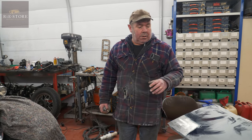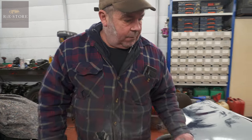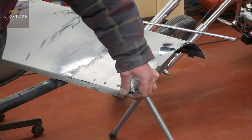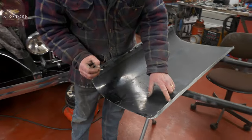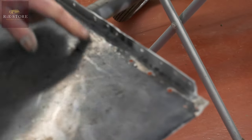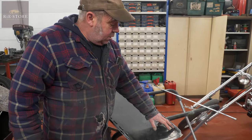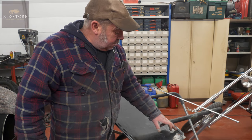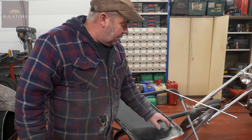He also asked to have the bonnets repaired. You can see that one's split there — that metal is no good, it's been welded but badly all the way in here to try and strengthen it up. The basic problem with aluminium welding is as you heat it, it kind of anneals it so it becomes softer. So welding it there isn't really solving the issue — what you've got to do is cut that out and come back to here.